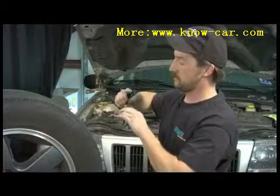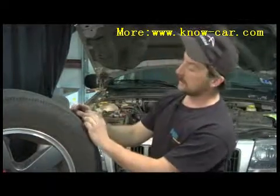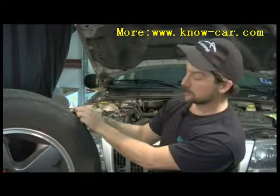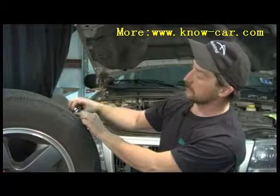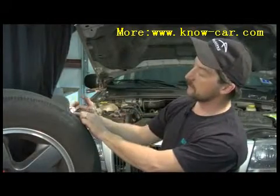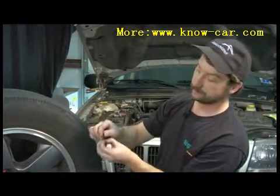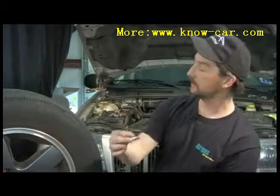It's pretty slippery. This would be sticking out of your tire like this. Double it up, and what you want to do is take either a razor blade or a knife or something sharp. Don't pull it out, just cut it off nice and flush with the tire — maybe even an eighth of an inch sticking out of the tire. You can see about that much sticking out of the tire is good to go.